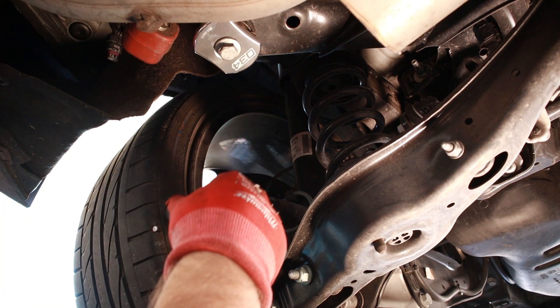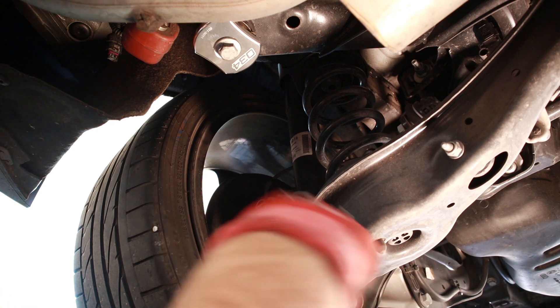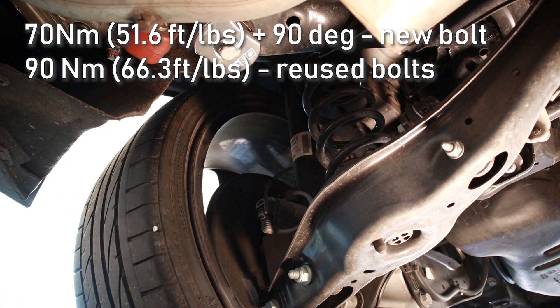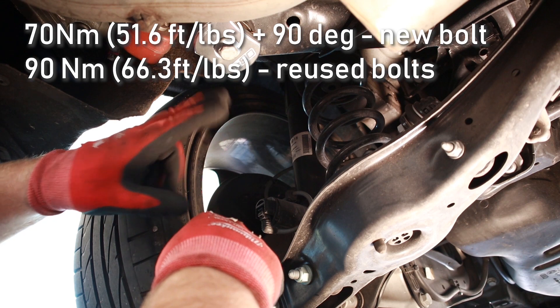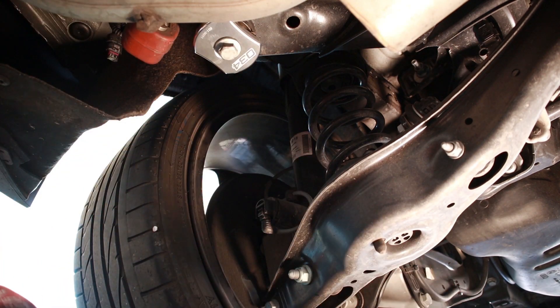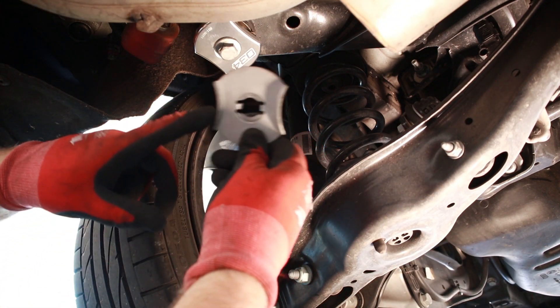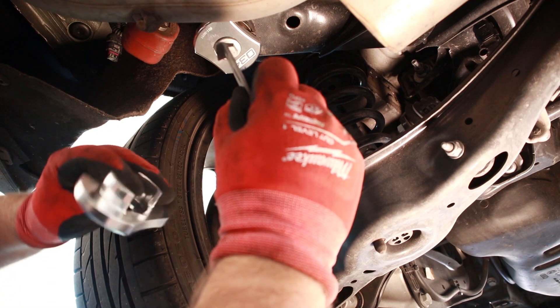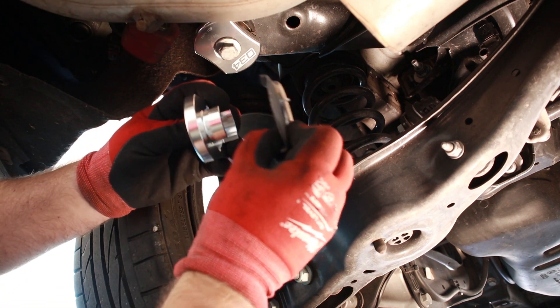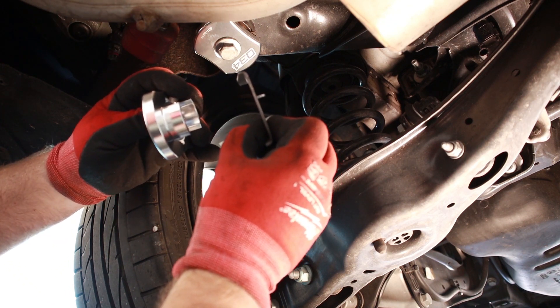Hopefully I didn't go too tight — this Milwaukee Fuel can go to about 55 foot pounds, and I'm pretty sure these go down to about 37 plus 180 degrees. Let me put the spec up on screen. That was pretty straightforward — the most complex part was just making sure you get the angle to get the old ones out. By comparison, the thickness of these new guys is clearly different, and therefore you are removing a lot more of that movement in the rear end of this vehicle.